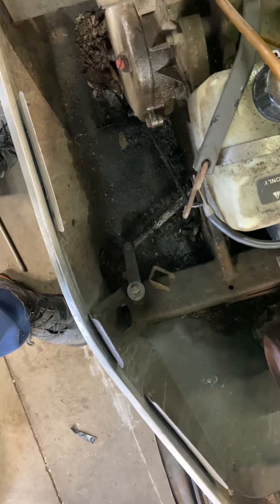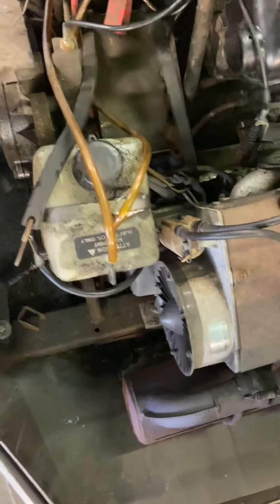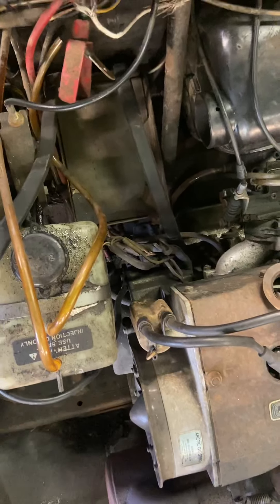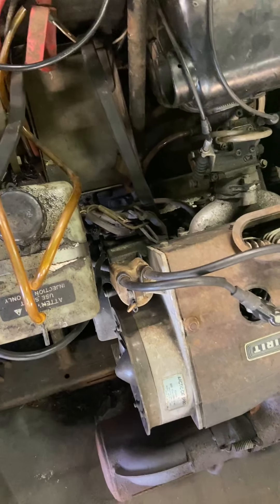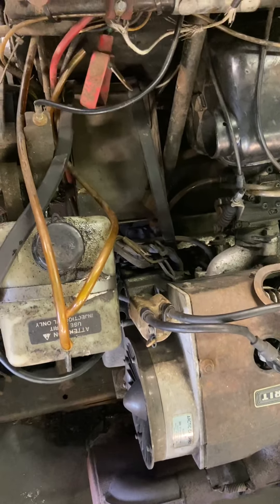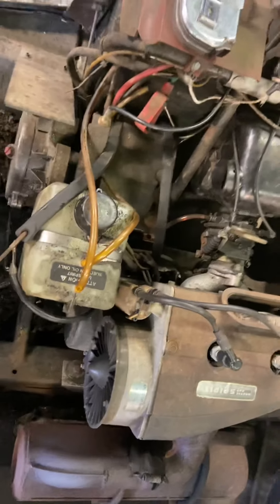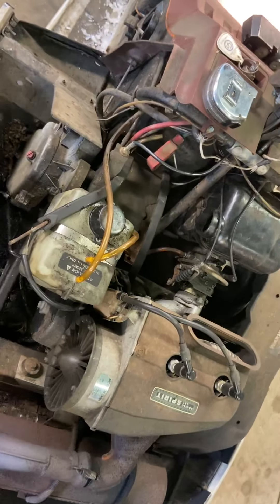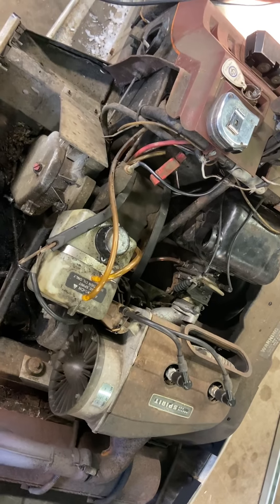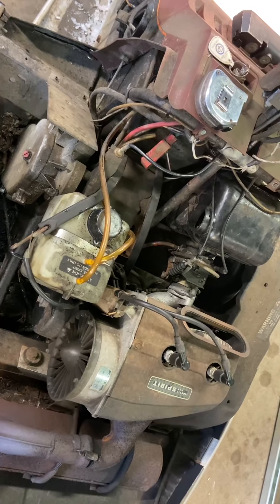The bracket at the bottom of the steering column is loose, and I'm going to guess nobody went at that because you're probably going to have to get the track out — or it's very tight to get up under there. The front side of the tunnel is where I think it's at. Never done these sleds before but I'm going to find out. Maybe in a day or two this thing will be ripping. We'll see — we'll keep you posted.